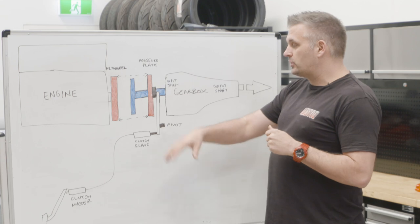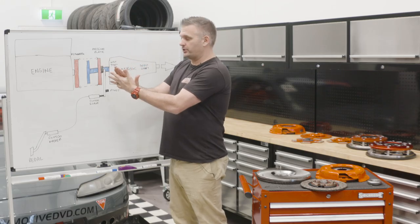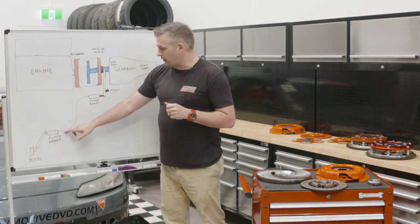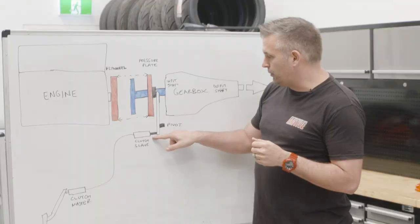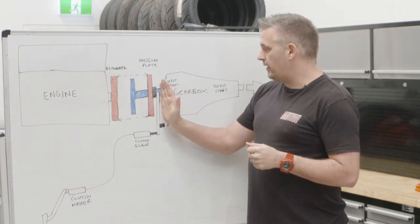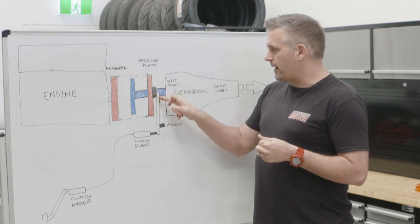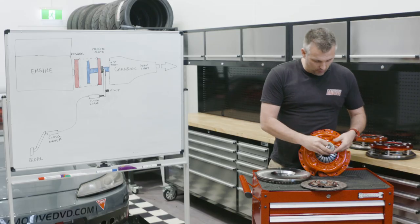Now let's take a look at how it works in terms of the entire system. The default for a pressure plate is that it is forced up onto the clutch plate — it is essentially engaged as its default position. So when you look at the system, you've got your pedal. Your pedal pushes onto a clutch master cylinder, applying pressure. That hydraulic pressure goes through the clutch line to the clutch slave cylinder. The clutch slave cylinder basically pushes a little rod that pushes against some type of clutch fork pivot arm. That clutch fork has to pivot against a pivot point — sometimes attached to your gearbox on the inside. It then pushes against the thrust bearing or throw-out bearing, which sits on the fingers of the pressure plate.